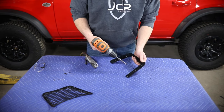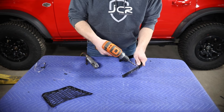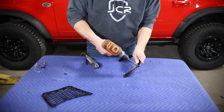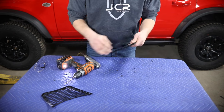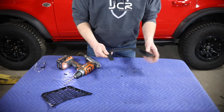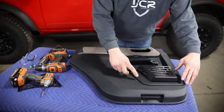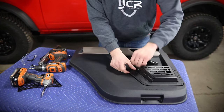Then you can just use the same quarter inch bit to drill all the way out through the outside face. Just be sure to remove any plastic shavings, and then this can be installed to the door with your new door pocket. If you're choosing to modify this outside trim, it'll just install right over top of your door pocket and bolt in with the same mounting hardware.